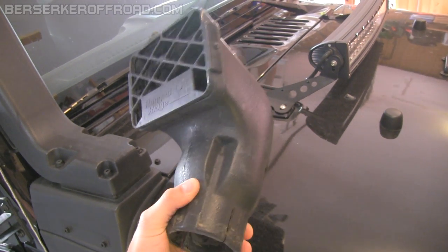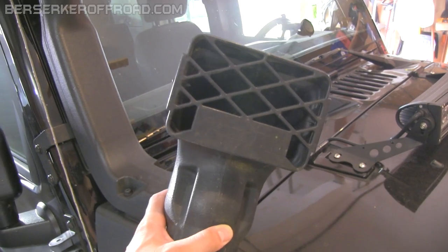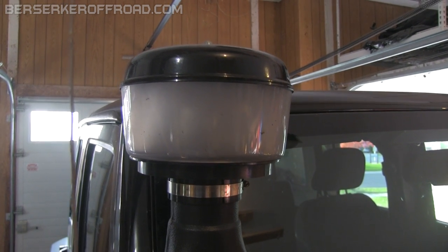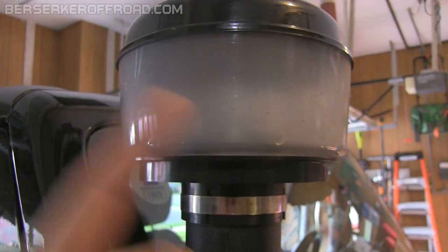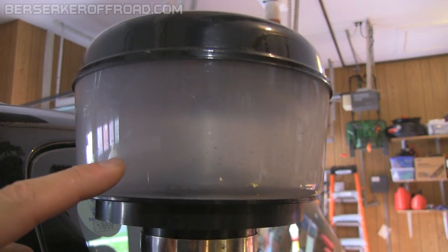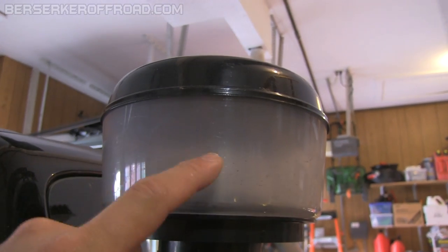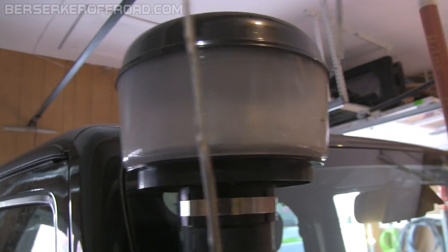This is the stock top that the snorkel came with. I ran it for a while but it was getting mud and rocks in it when I was going off-roading. I'd get stuck in a mud hole or whatever, and when I'd kick up mud from the tires, the mud would go straight down in it and clog up the little drain. So I ordered the pre-filter and I'm much happier with it — I highly recommend spending the extra $55 to get the pre-filter instead of the stock top. Air gets sucked in and spins around inside the pre-filter, and the heavy junk like dirt, bugs, or rocks settles inside the cup. The cleaner air goes in the middle and then down the intake to your filter, pre-filtering out all the big stuff. This keeps dust from getting to your filter, which then cleans out the smaller stuff, so it's a great way to keep your real filter cleaner longer.